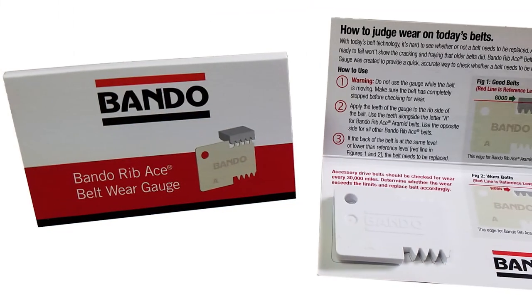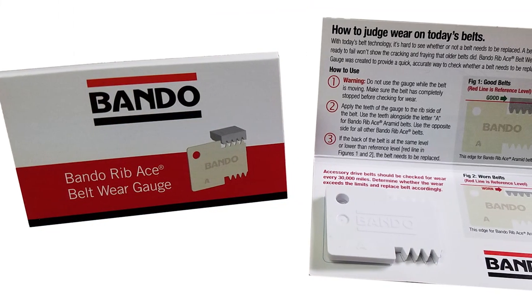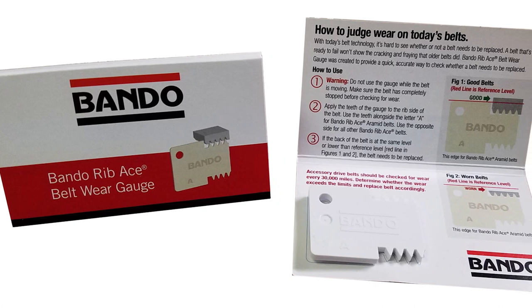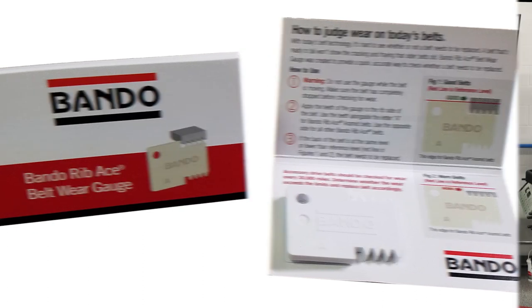When inspecting a stretch belt, your customer always should measure the depths of the grooves with a belt gauge, since the differences between a worn belt and a good belt can't be seen or felt. The new materials used to make a stretch belt don't crack before the grooves are worn.